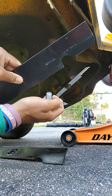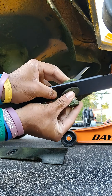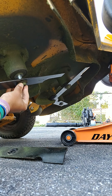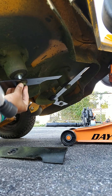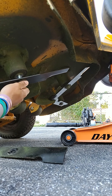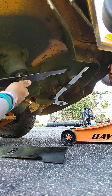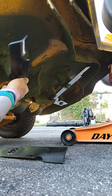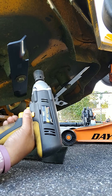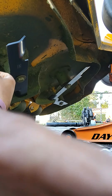For mine, I have a washer on top of the blade, another washer at the bottom, and then the nut goes through the middle. Now, this is important: never use an impact gun to initially thread in your bolts — you do not want to strip out the bolt, because that's another expense. I hand-tighten mine until I can't anymore, then finish it off with the impact. The impact's full power is really only for getting the nut off.